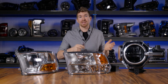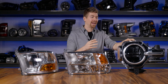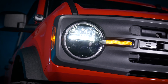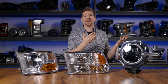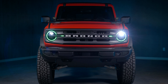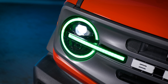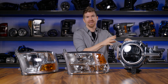Since we made this video last time, there are a lot of other reflectors on the road, like this one from a Ford Bronco. This one is an LED reflector housing — it's got LEDs built in and then the LEDs bounce off the reflector and shine out. Since this one is an LED reflector from the factory and you can't just change out the bulbs, you're going to have to look into replacing the whole headlight assembly to something like the Morimoto XB headlights. These have an LED projector built in, and you can't upgrade these bulbs either because they're already good from the factory. Not only will it be a better improvement for light output, but it's arguably going to be more stylish too.